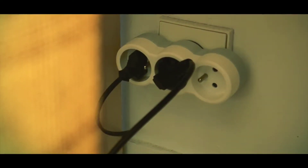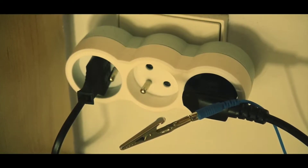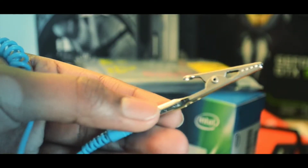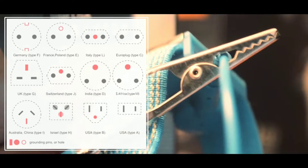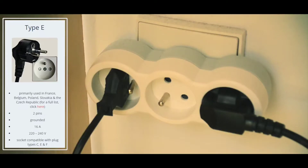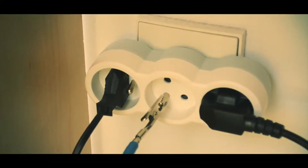So what you'll need to do is find a grounded outlet near your workspace. A grounded outlet is one that has three prongs. Then you'll need to plug or clip the other end of your anti-static cable into the grounding hole or pin. This is usually the odd one out — do not play the guessing game, as you could suffer from an electrical shock and possibly die if you attach it to the wrong one. I recommend you find your socket type's grounding hole or pin using the links in the description. I live in France and I have type E outlets, so my grounding connection is the pin sticking out. And bam, I'm grounded. Electrically. The switch doesn't even have to be on. Now I can go back to building my PC.